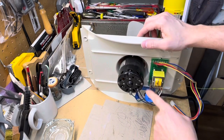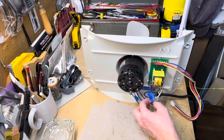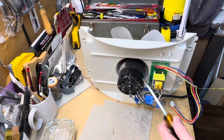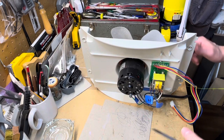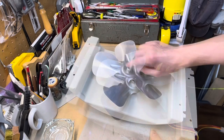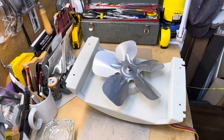That is still hot right here. I labeled the wires — you have your ground wire in the back and then two power wires that connect to the circuit board. To get this out, I'm going to let this rest back on the motor to take off the screw here to lift the fan blade off.